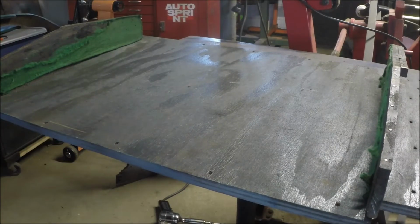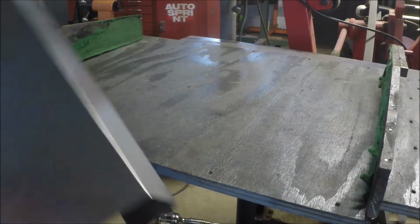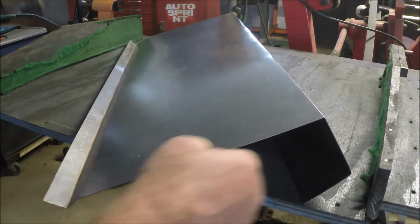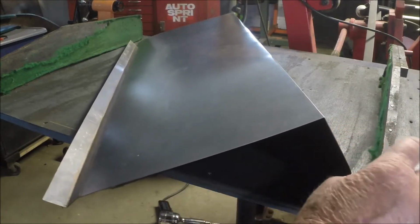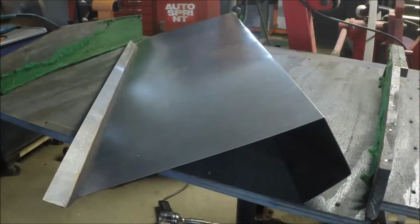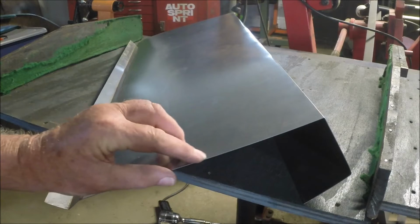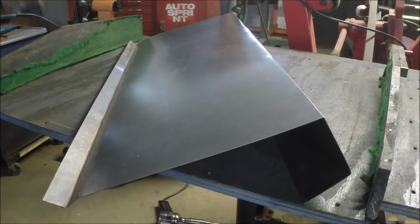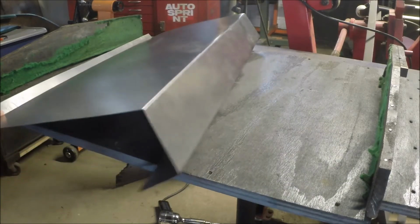I think what we'll do is get this metal, and at some point punch some little holes in here, because they just nail this to this rib. Looks like it's 1, 2, 3, 4, 5 nails or so up there. So we take the Whitney punch and pre-punch some holes in there, so we're not trying to beat a nail down through that sheet metal, and get this pan to the point where we can get it on the box, and then we can get the box on the car and see how it all fits up. And of course, when we get our new wood, there are some other pieces that go on here, so things will start coming together, hopefully.